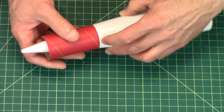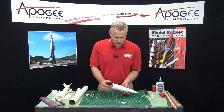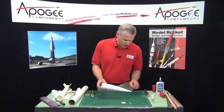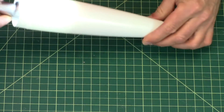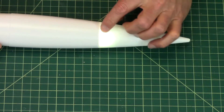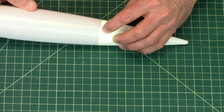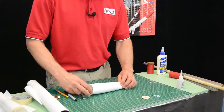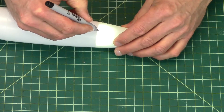I don't want to cut from the outside — I want to do it from the inside because of the thickness of the plastic. So how do you see where to cut? Well, you take a flashlight — I've got a bright flashlight here — and you can slide it inside and you can see the line that it makes. Push it as far forward as you can, then take a marker and mark on the outside.